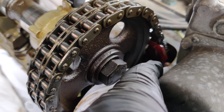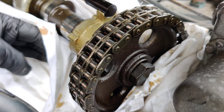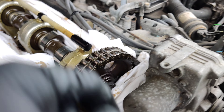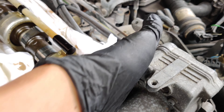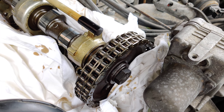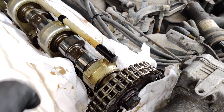Let's see what happens. I'm gonna need to do a little research. Any input would be greatly appreciated. I know a lot of people say to do the chain and the oil pump, but my chain — at least on this side — doesn't seem to have much play. I'm more worried about the guides than the chain itself. I haven't seen many chain snaps but I hear about guides. So I'll probably just go ahead and change these since I have them.